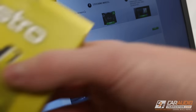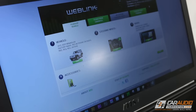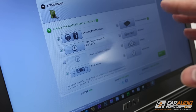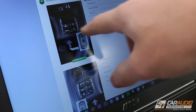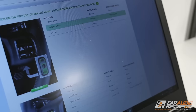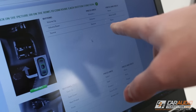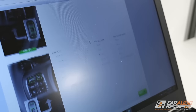You then put in what exact radio you're going to be using, and tell it which harness you have — in my case, the CH1. You can move on to OEM systems, where you can select what you want to retain and what you want to get rid of. In my case, I'm actually deleting the Uconnect and using the aftermarket radio completely to control all phone functionality. You can tell it what else to leave on or off, then hit Next. It will then show pictures of the steering wheel controls, and hovering your cursor over each one shows what it's programmed to do — and you can even program different actions for press-and-hold.